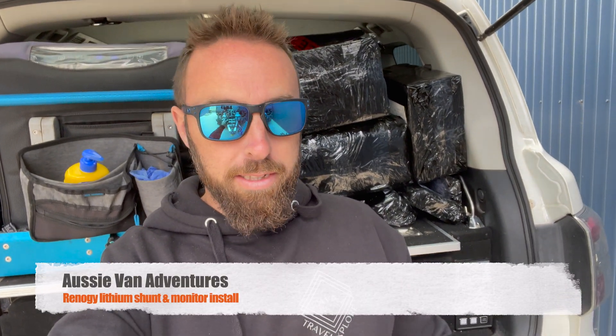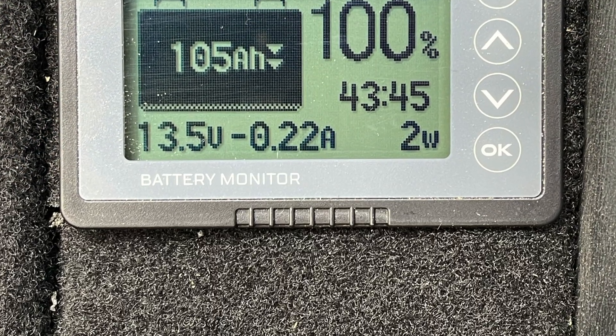Hey, how are you guys? This is basically a little video for those of you who have lithium in the car, or are thinking about putting lithium in the car and need a battery monitor. There's not a whole lot of options out there, there are a few. I'll put a couple of links down below of some of the options. I'll also put a link to the item we'll be installing today, which is the Renogy battery monitor shunt. A friend of mine suggested it and it fits everything I need. It's relatively cheap for what it is. A conventional volt meter you'd use on AGM batteries isn't going to give you a true reading for the lithium state of charge. You really want to know what percentage of the battery is left and how many amps you're using. There's a heap of information on this little gauge and it's really helpful.